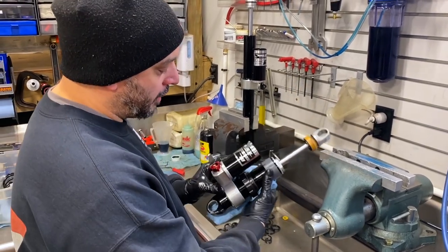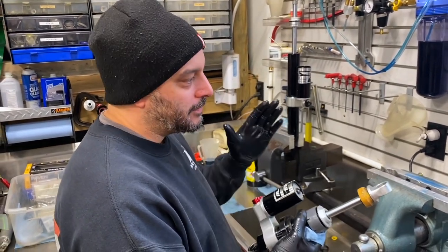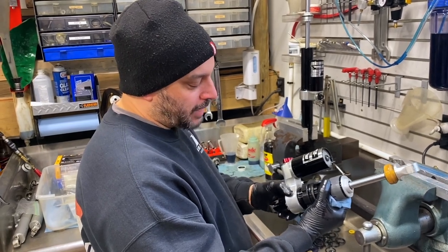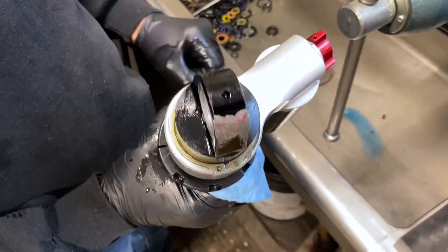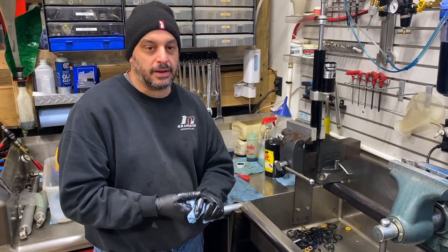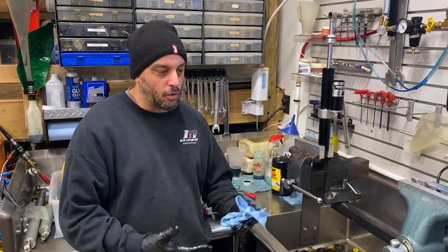That was just a quick assembly of this Walker Evans — this one came in a 2019 Axis 800/600. It does come in other models; I believe it's 2018, 2019, and even 2020. You have to be cautious: the newer ones changed the design and this is no longer an issue, but in those few years you really want to make sure. This is what I was talking about — the two-piece lock collar goes over the snap ring and pinches into the aluminum. Hopefully that gives you a little insight, and we're going to have more to come — some other different shocks, vacuum bleeding, running things in the dyno, and explaining shock fading internally. Thanks for watching!